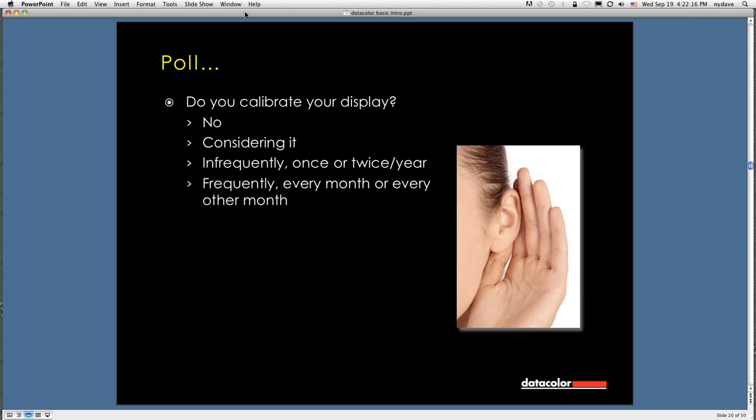The displays do change over time — the backlight ages a little bit every day. Here's a tip: if you have a tendency to leave your desktop unit on, there's no problem with leaving the computer on, but turn the display off overnight. Don't use it as a nightlight, because that backlight has a limited lifetime. If it's turned off at night, it'll last longer.